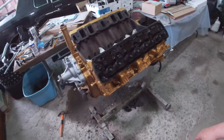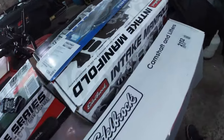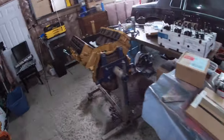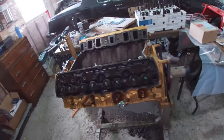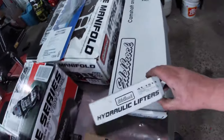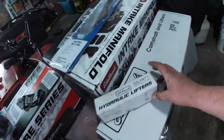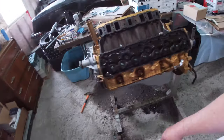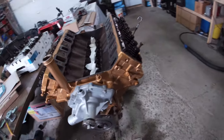When we left off I decided to pull that timer cover and yank that camshaft out of there, so that's exactly what I did. Then I got Edelbrock part number 2152 camshaft and lifter kit for Oldsmobile 400 to 455 big blocks. That bump stick is now inside our torque box - more power baby. This kit came with a set of hydraulic flat tappet lifters, part number 411511. I think they use the same ones in Pontiacs and Buicks but you can correct me if I'm wrong. Then we got our double roller timing chain installed.